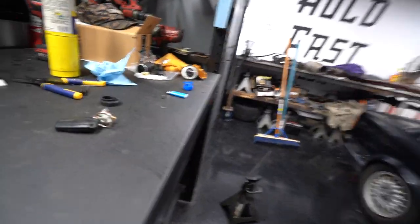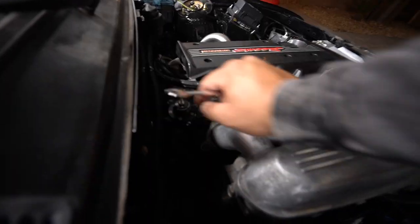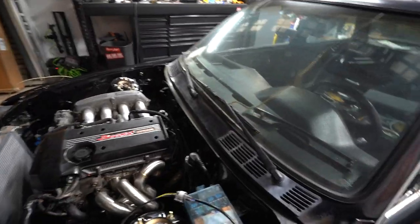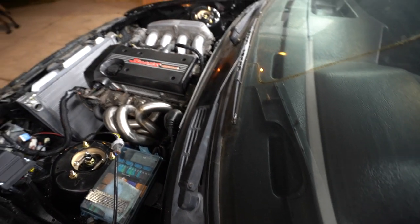Let's try it now. Maybe the fuel pressure regulator — to increase pressure, we'll turn it to the right. Figured it out: fuel lines are backward. That's a bummer, but it is what it is. Should have done what I said to do and it didn't. So let's try it now, see if it'll fire.